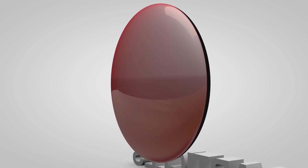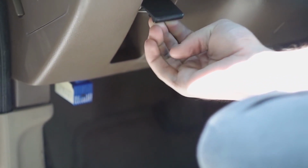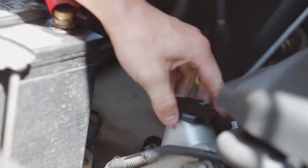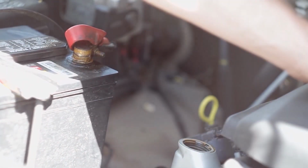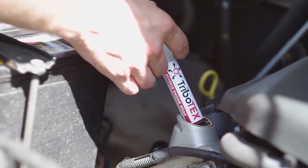That's one part of it. But that coating is not just thick and protective. It is also more lubricious than the material was before. So the bearing becomes more efficient. That reduces heat and reduces fuel consumption a little bit. Overall, those benefits are very useful for everyone who wants to keep their car longer and retain efficiency over the long term.